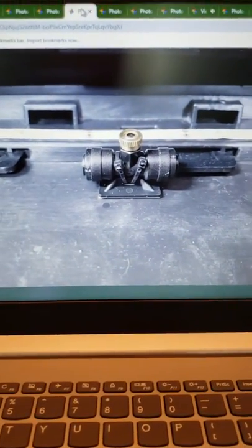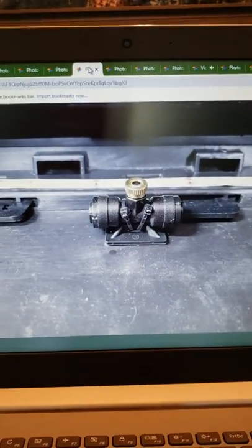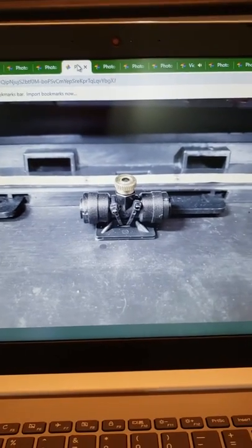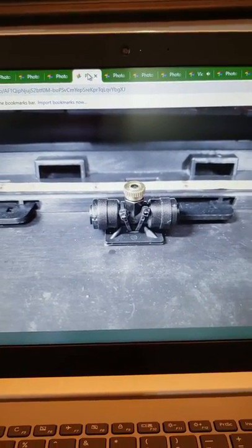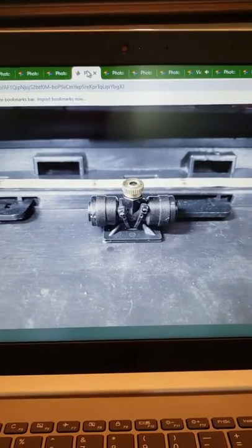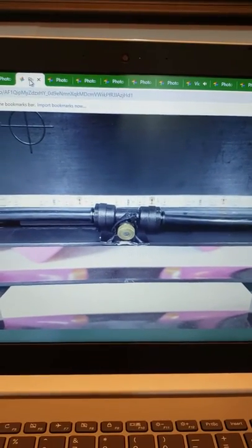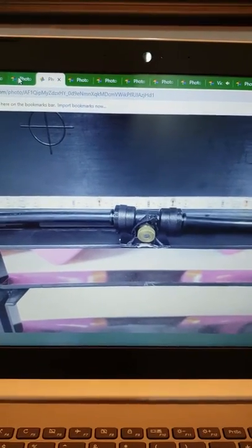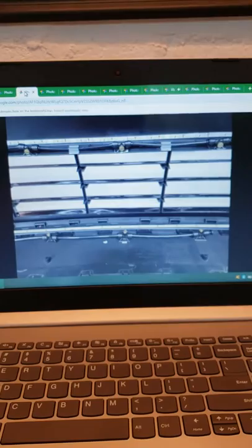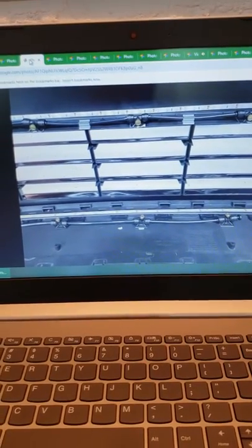Here's a jet — I have an extra one to show. I'm figuring out a way to mount them to the bottom of the bumper to shoot straight up in a conical pattern. As soon as it sprays up and through the first row of openings at the lower grille, the air will push that conical spray back into the lower portion of the intercooler. There's another one with the line hooked up at the bottom of the bumper. This configuration at the top of the grille within the bumper will satisfy the top of the intercooler. What I chose to do was run three nozzles along the top and three along the bottom — and the bottom right corner one is a dead end. The kit also comes with a stopper that you can plug into one end of the double-ended nozzles to dead-end the flow.